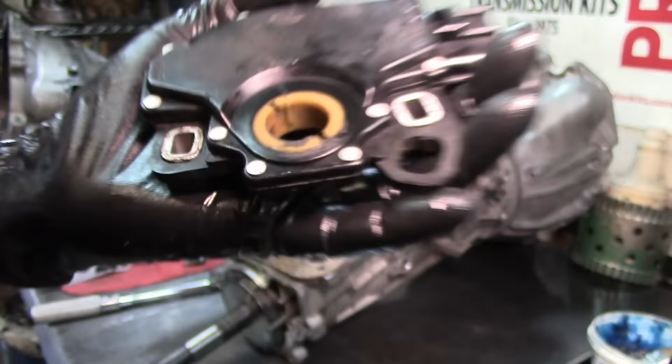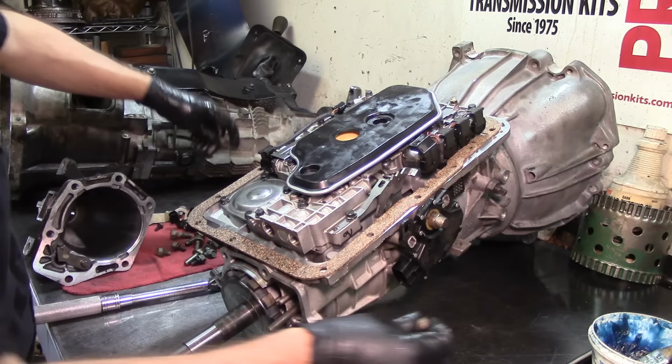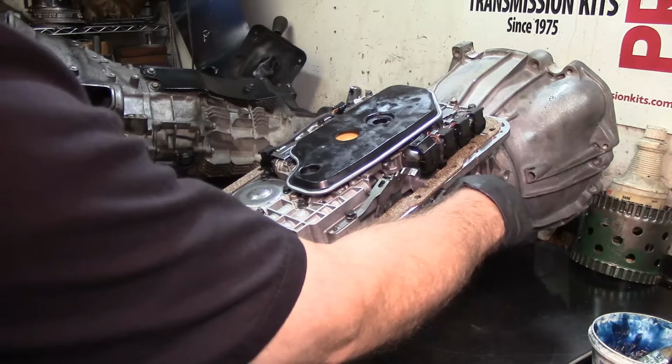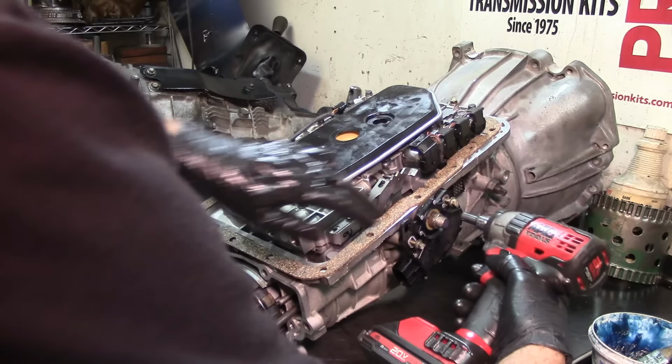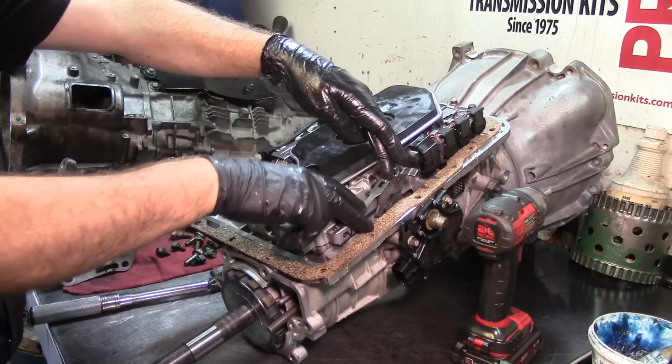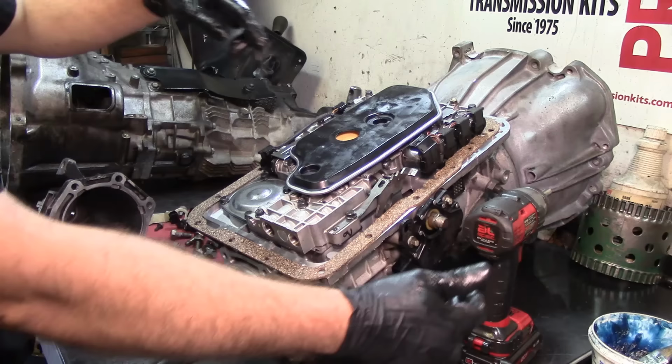Now you slide it on there. Put your bolts. And let me get the socket. That's it. That's why you align it in neutral, or when you put the detent roller, you set it on neutral, and then neutralize your range sensor and align it.